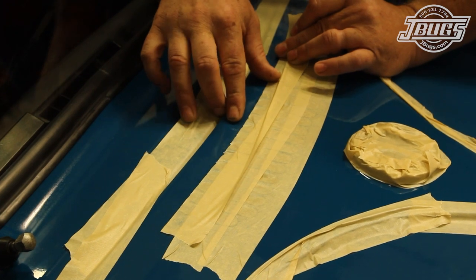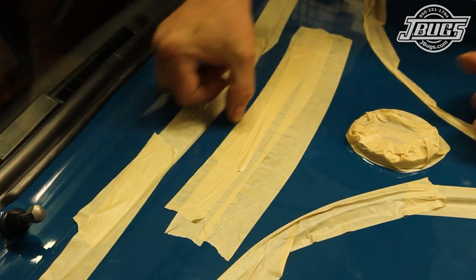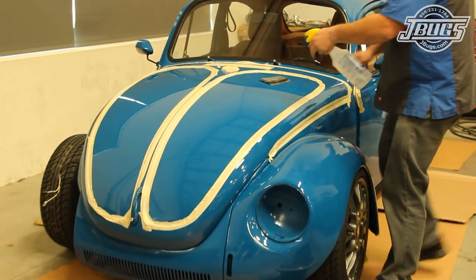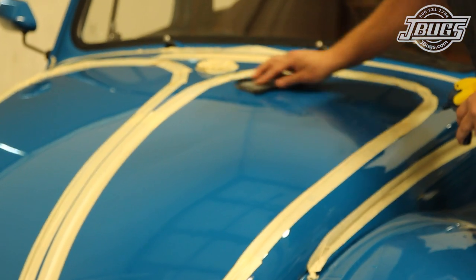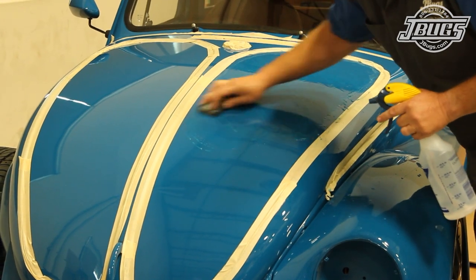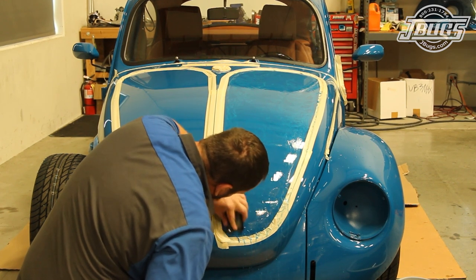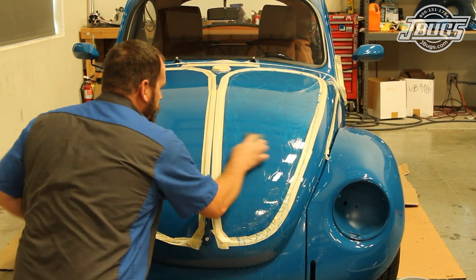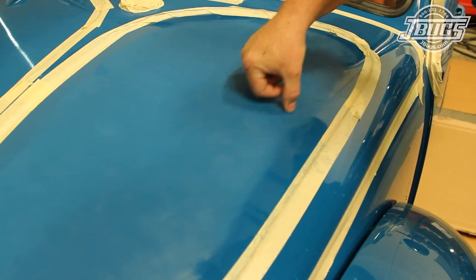We did have some sags in the back edge of the hood at the fresh air vent, so we'll have to sand here but we'll be extra cautious. With the hood taped off and wiped clean, we'll do a quick demonstration of the process. We start with 1000 grit sandpaper that has been soaking in a clean bucket of water, a soft sanding block, and a squirt bottle filled with water. We begin sanding with a wet surface and we'll keep the surface wet to keep the sandpaper clean. Since we have a single stage paint job with no clear coat, as we sand, the blue color we see is the actual paint. We'll keep away from the taped edges as much as possible, as we don't want to see a line where it's sanded.